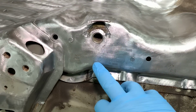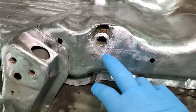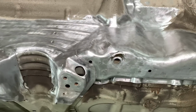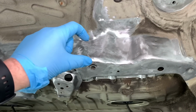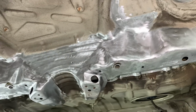That one looks a bit odd, doesn't it? You can see how nice these ones are and these ones. That one up there has already been plugged and replaced with us today, and that one are going to need some further work when we get onto this stage of reinforcing or repairing the internal platform which stabilizes the threaded receiver. And what a threaded receiver is the thread up there, which is what the subframe bolts screw into. So that shows you where we are.